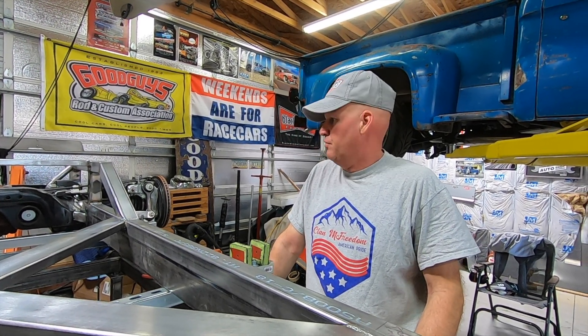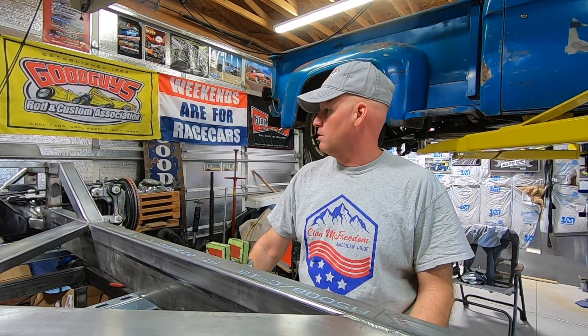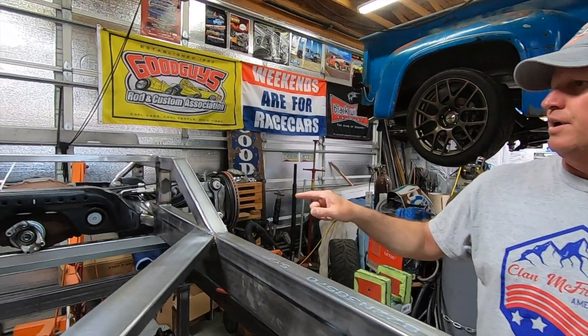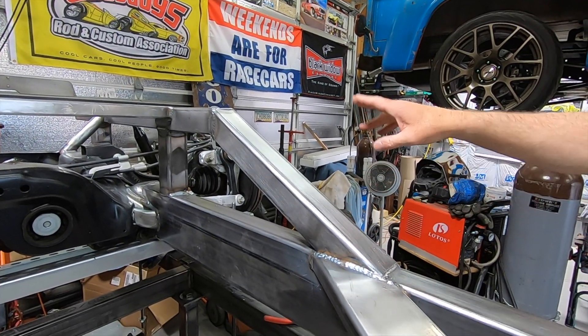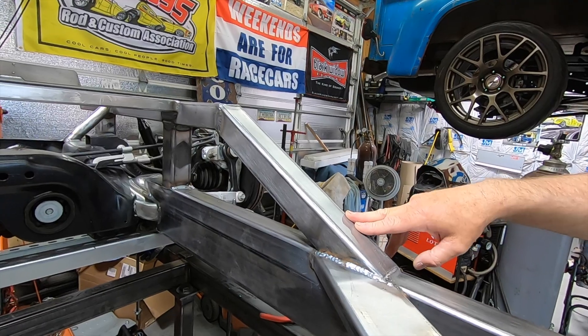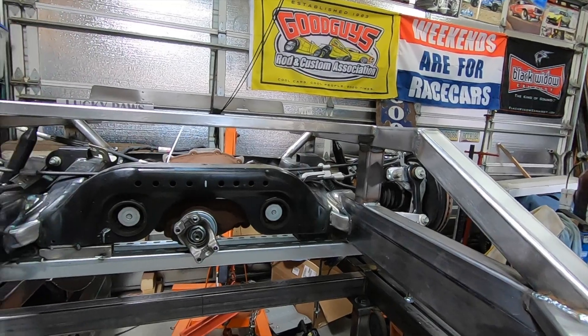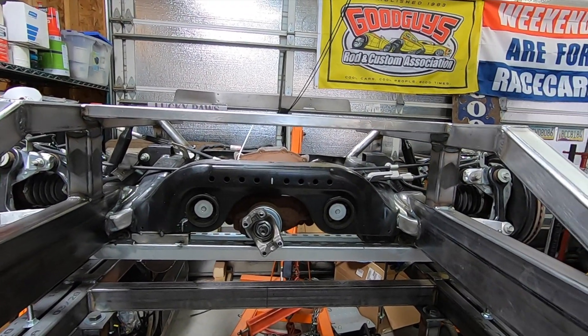So we're back on rebuilding the F-100 frame. We've got most of the rear of the frame done now. We have the main beams grafted onto the IRS subframe, and then we built this bridge to kind of help raise the forces to the back of it into the main beams. It'll also carry our coilover mounts and help support the back half of the frame when we get that set up.